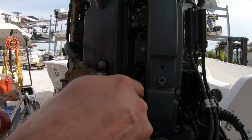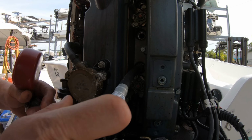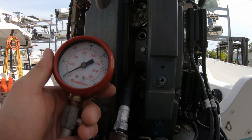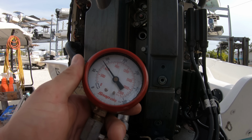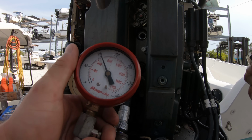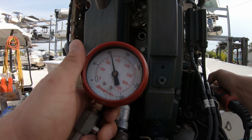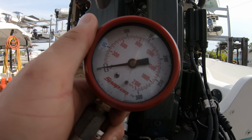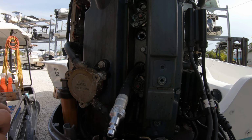If the engine hasn't run in a long time and has been sitting, you can start the engine and let it warm up a little bit to get the exact results. Otherwise, you shouldn't see this difference if the engine is in good health. The oil pumps build oil pressure in only a few revolutions of the engine, so the piston rings will get some oil on them pretty quickly, giving us some pretty good numbers.